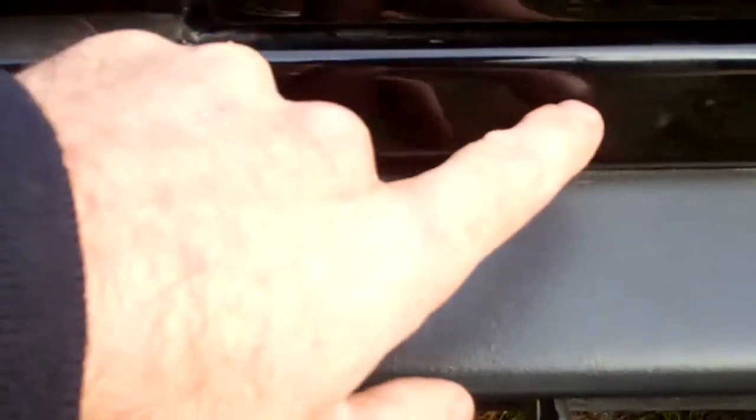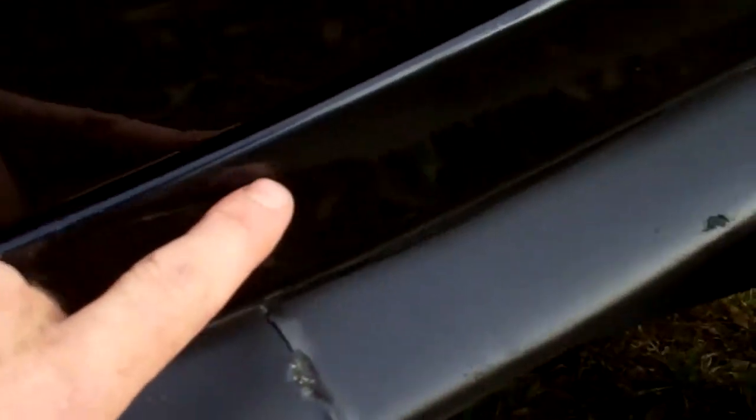Here we go — it's not overspray, it's primer, just here. Same with here as well, in this corner. It's been resprayed somewhere here. It's taken a bit of a knock. They've left primer on this side as well, on the inner edge. You can see that greyness there — it's obviously where it's been slammed. There are a few bubbles in the paint here. You've got craze crack right here — you won't be able to see it because it's not really the right light, but it's just forming in that section.